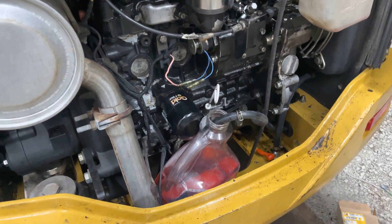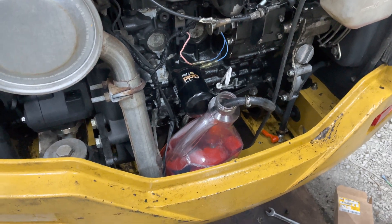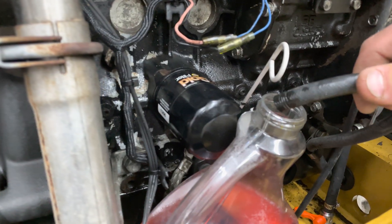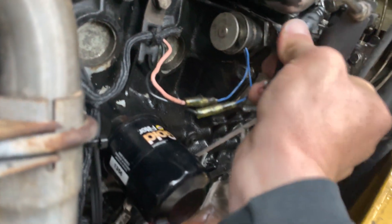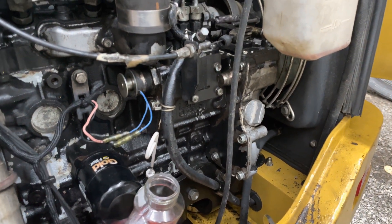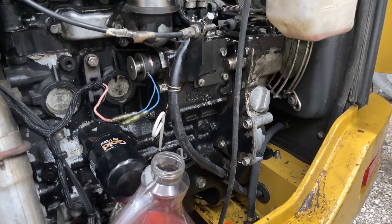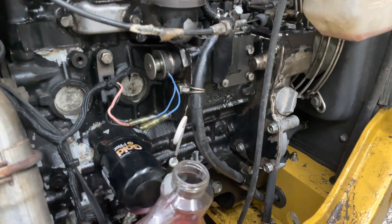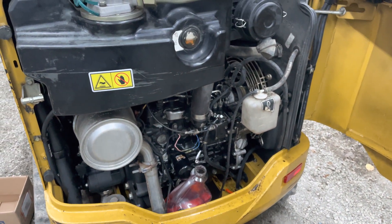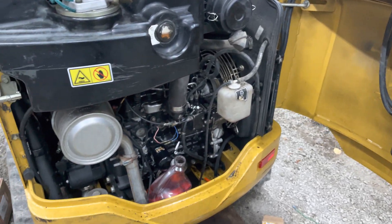And that was obviously my problem. Replacing the fuel filter — which I think had 500 hours on it — and the lift pump probably helped, but at the end of the day my real problem was the air getting into the line. Hose clamps after the lift pump are important, but they're not as critical as on the vacuum side, because on the pressure side you'll obviously see a diesel fuel leak if they're leaking. I know there's a lot of talking, but I hope that helps some guys out going through one of these. If you have a similar problem, at least now you know how the fuel lines are routed. Thank you for watching.